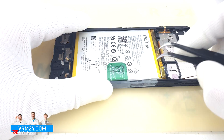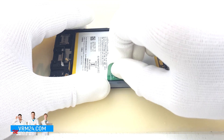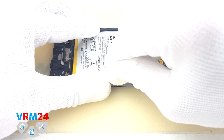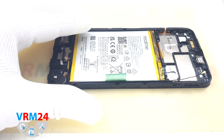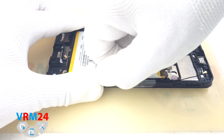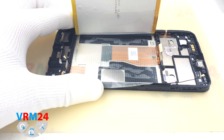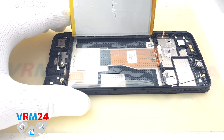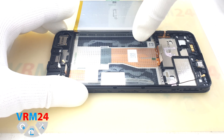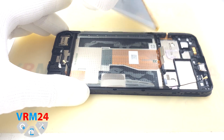We can detach the battery. The white or transparent film is the cable protection under the battery. The green tag — we are pulling on it. The battery isn't really glued on. Under the battery is the protecting covering, and there is an interboard cable.